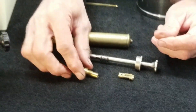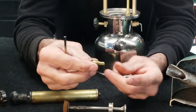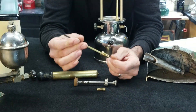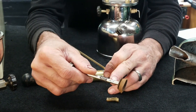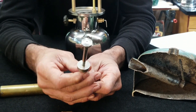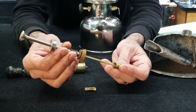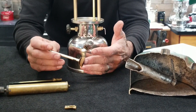There is a safety device that goes with the check valve called the air stem. The check ball on the bottom blocks air from returning in one direction. The air stem is a second stop — a safety device — that screws in from the top. When it is all the way screwed in, it completely blocks air from flowing in either direction. The air stem is controlled by the pump stem — the pump is squared there and it fits in and turns. Everybody has seen the instructions on the end of the pump that say 'close.' When you turn this clockwise to close it, you're actually screwing that air stem into the check valve and blocking it off so no air can get out.